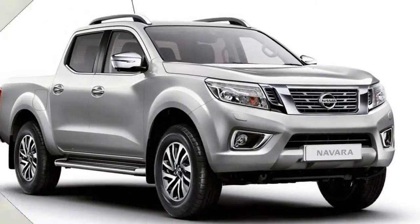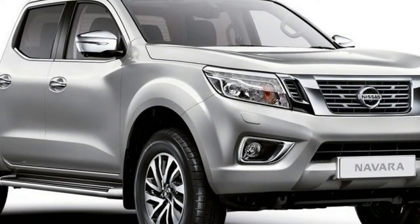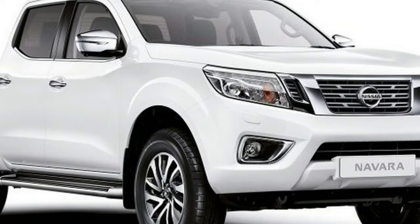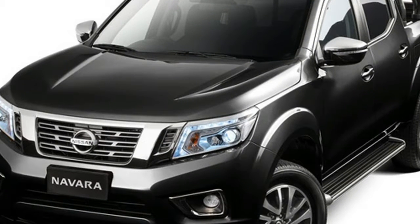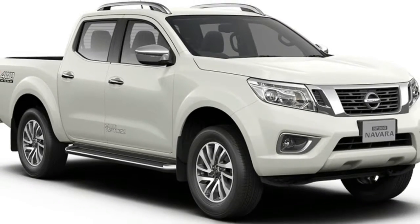It is one of the most convincing takes on the theme, because it uses a suspension setup more akin to what you would find in an SUV, rather than a workhorse ute. In the past we've made a bit of a deal of the shortcomings of the Navara's five-link rear suspension setup, which isn't like any of its mainstream rivals, all of which utilize a leaf spring arrangement to deal with loads.